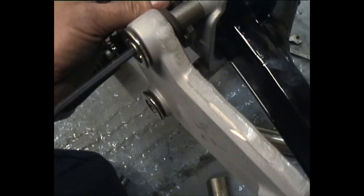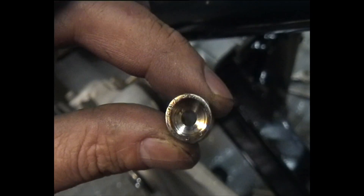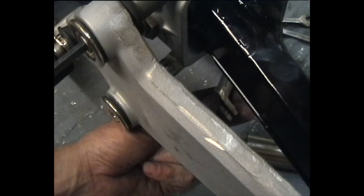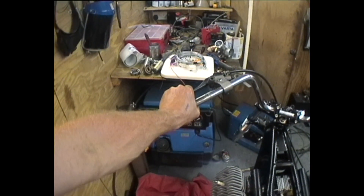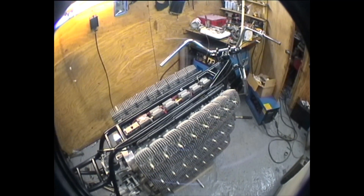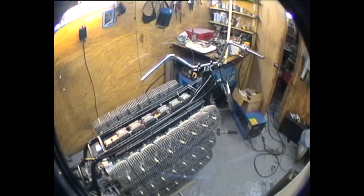The clutch cable will go into the end of that — it's an 8mm bolt drilled out, which gets welded on there. That will actuate the clutch arm. It's been welded on at a slight angle. On the finished article, you pull in the clutch lever — it doesn't move particularly far but it certainly works. That's in gear and when you pull the clutch in it disengages fine.